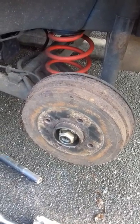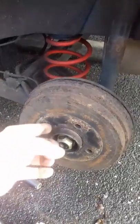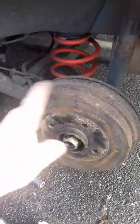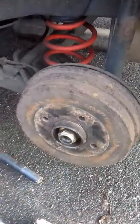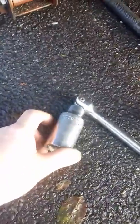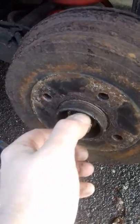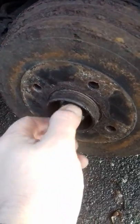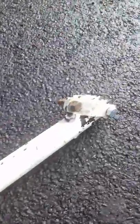Remove the road wheel after removing the lugs, hub nuts, whatever you call them. You're left with the drum and a lock nut. The lock nut is 30mm in size, and it's torqued up to about 175 pound-feet - check the exact numbers. To get it undone I needed the socket, a handle, and a long extension.